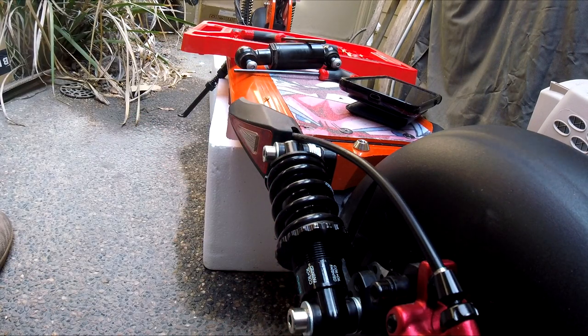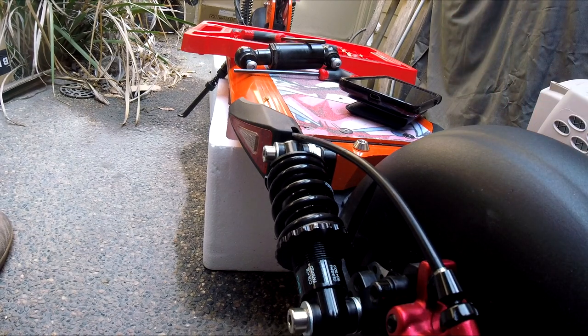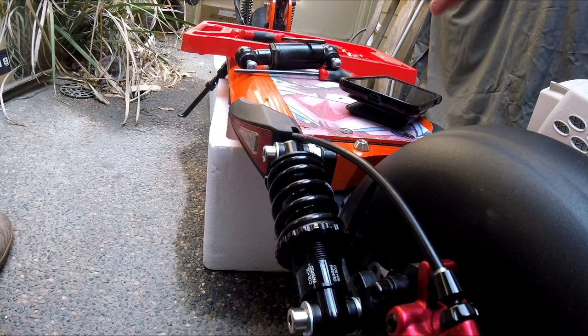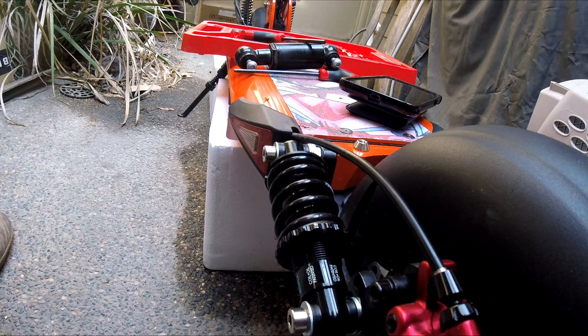It is super simple. One thing I will note, and I can't show you in the angle that I'm at, is watch this cable for the brake line or brake light that comes up through here. I was noticing that I had a sound, and I actually thought it was the brakes because it was like a da-da-da-da-da-da-da-da, and it actually ended up being the cable was a little bit loose in there, and it was rubbing on the tire. Definitely, wearing headphones and ear things are perfectly fine. I do it, but I would definitely keep an eye or ear open for different things.